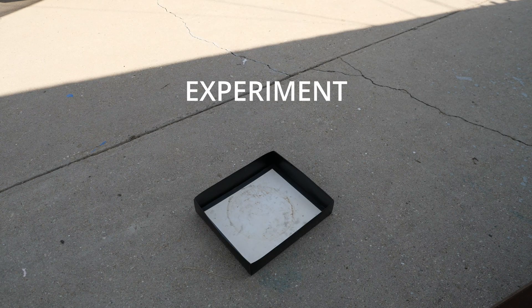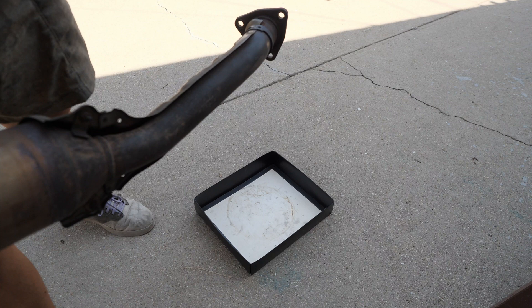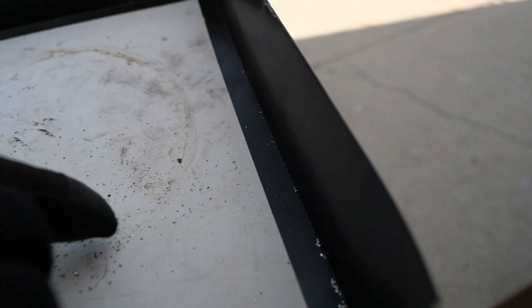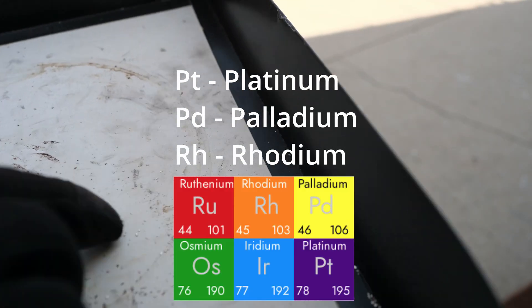We're going to do a little experiment. We're going to take the front pipe with the clogged cat and dump it towards this box. Well, not as much came out as I thought, but look at this — it looks sandy, like sparkles. This is part of the catalytic converter — all of the rare earth metals. Some came out as dust when I took it off, and this is the heavier stuff, almost as big as salt grains. You can imagine those getting clogged up.